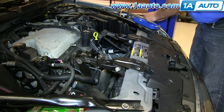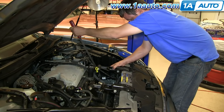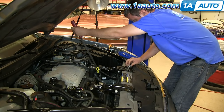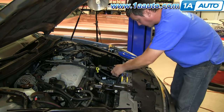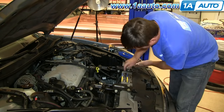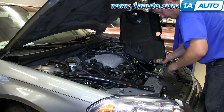Remount the upper engine mounts on the engine side. Use a large pry bar and stick it in behind the engine mount and give the engine mount a pull to get the bolt started along the front support. Start all the bolts first that go onto the front support, then tighten those up nice and firm — you should tighten them to 50 to 55 foot-pounds. Same thing with the mounts that go to the engine: those bolts and nuts 50 to 55 foot-pounds.